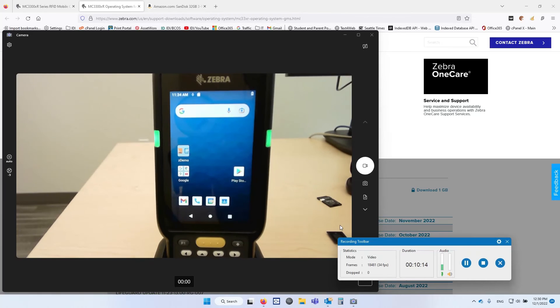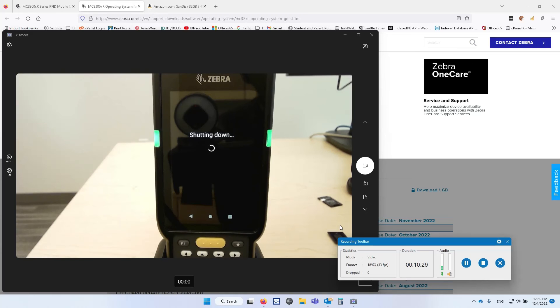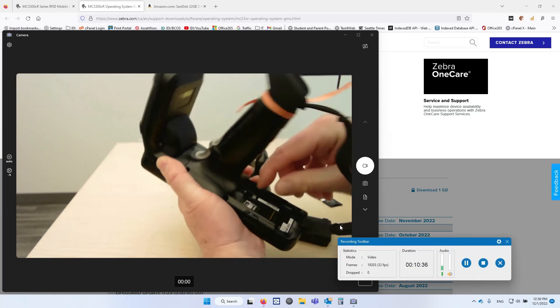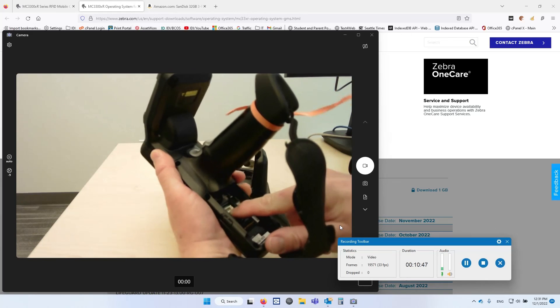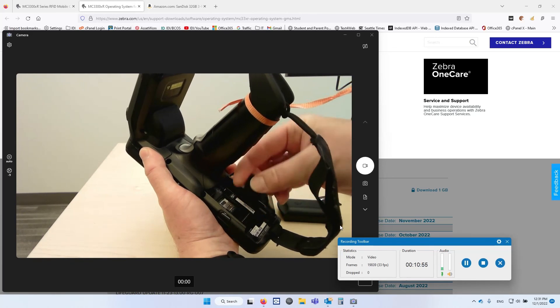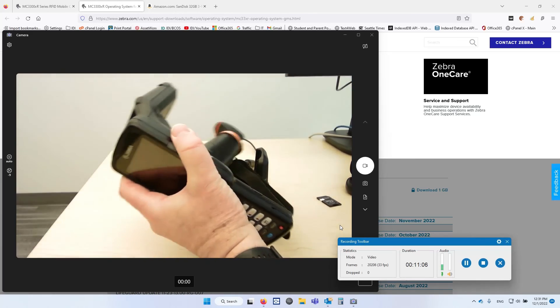We can shut it down — hold the red button. In Android 11 the power-off option is at the top now, different from Android 10. Hit Power Off and let it shut down. Take the reader out of the dock, remove the battery. Remember, slide up so the clip comes up, then you can take your chip out and save it for another reader. Pull the cover back down to snap it in place, don't forget your little cover plate, put the cover back on, and put your battery in. Repeat that process for as many readers as you have.